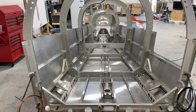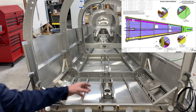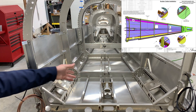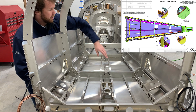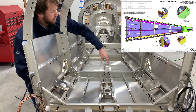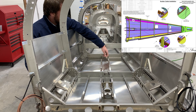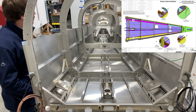The next step is your rudder cables, which are fairly straightforward and install easily. A box gets mounted and riveted in here. The key thing to make sure of is that your cables cross — plastic guides are factory-positioned here, here, and here so the rudder cables cross through this section. It's very important that they cross so you get correct rudder control.